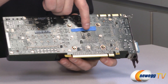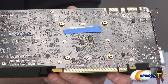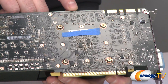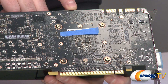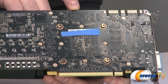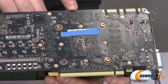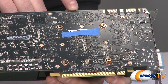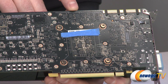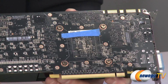Right here in the middle under that X pattern is where your GPU sits. The code name for this GPU has been Kepler, recently launched as the GTX 600 series — the specific GPU is code-named GK104. It has 1536 CUDA cores and a base clock of 1006 megahertz. It also has a boost clock feature: similar to how a CPU throttles up under load, this GPU can boost up to 1058 megahertz under load and back down to 1006 megahertz, giving you a nice performance bump.